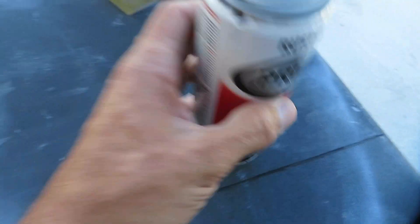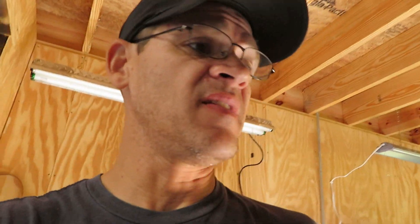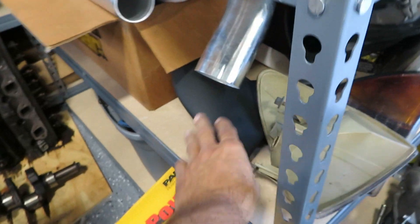I'm going to keep putting coats of high build primer on it until I get it looking the way I think looks good. I just basically went where there were large cracks, filled them in with the bumper body filler, sanded it down, and now I'm doing the high build until it looks pretty decent. Then I'm going to use the SEM trim black — it's kind of flat and I've been doing all my other exterior parts in that too, so it's going to match really well. I've got the rear view mirrors done and all the trim parts for the outside of the car.